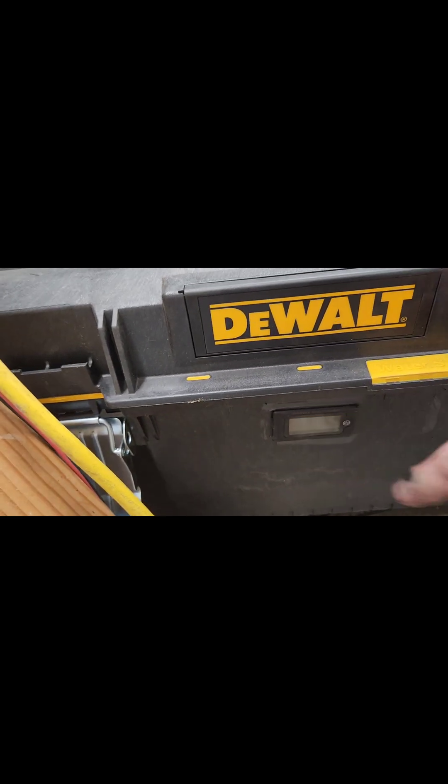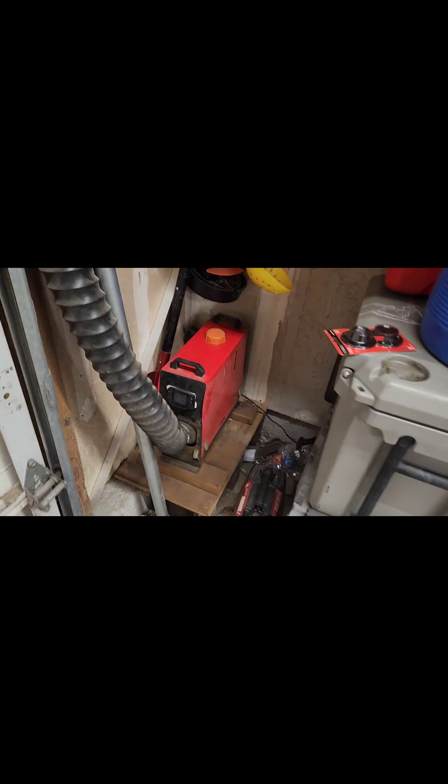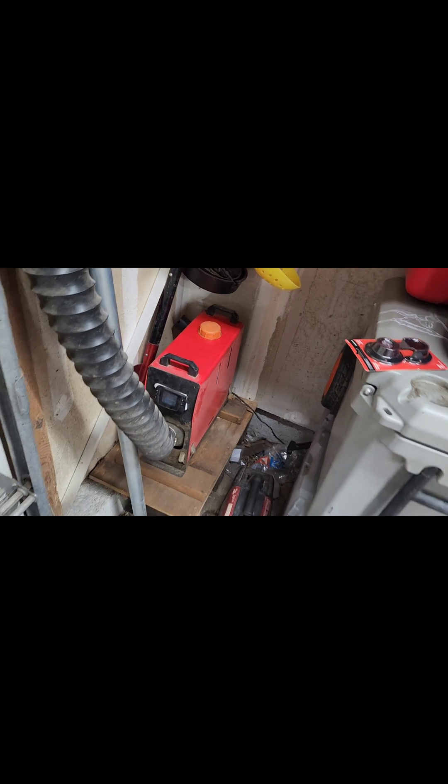We're going to check the health of our batteries here. We're at 12.9 volts — we started at 13.3. It says we're still at 100%, but I'm guessing it'll start dropping quick when it does. We've been going for close to 18 hours now and we're still rolling on those two batteries. Still got about half a tank of fuel in there, so we're just going to keep rolling.